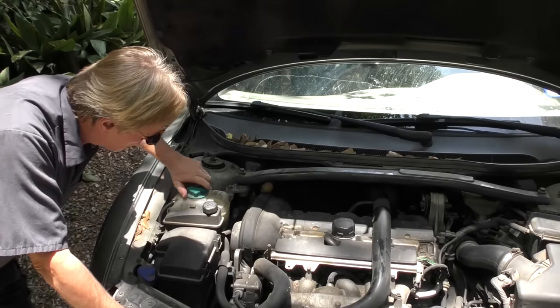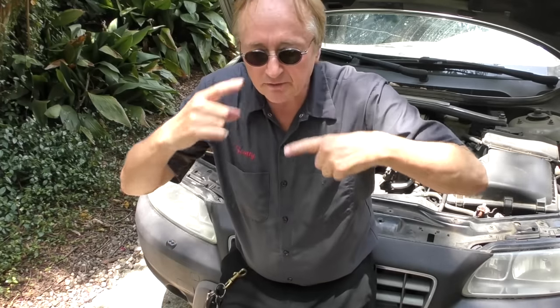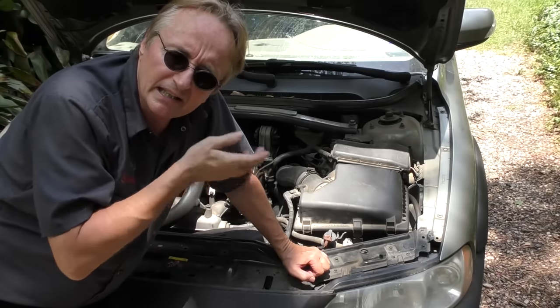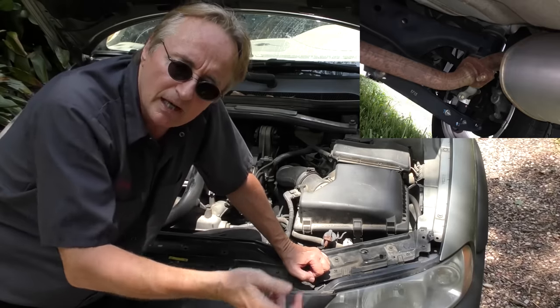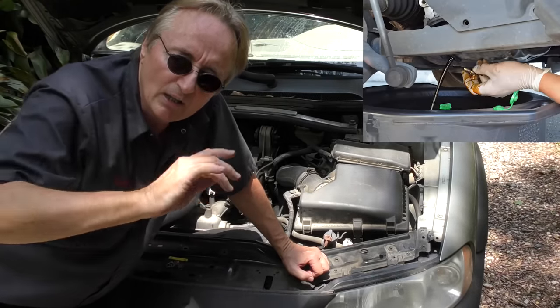Since many modern turbochargers are also water-cooled, make sure you have clean coolant. These turbochargers spin at thousands of RPMs — water-cooled ones have water seals, and oil-lubricated ones have oil seals. Dirty coolant or dirty engine oil creates friction, which heats up the seals. Replacing a turbocharger can cost thousands of dollars, and it's a difficult job because they're bolted onto the exhaust system. All that heat means the metal is practically welded on and rusted; parts often break during disassembly, so keep the coolant and oil clean to avoid that.